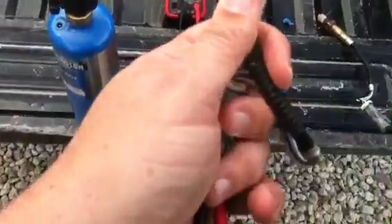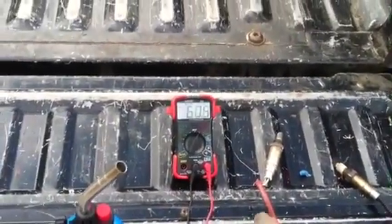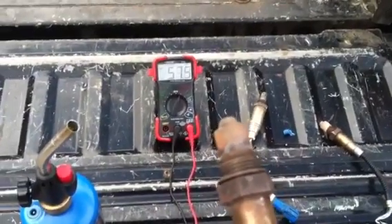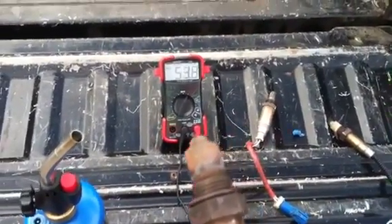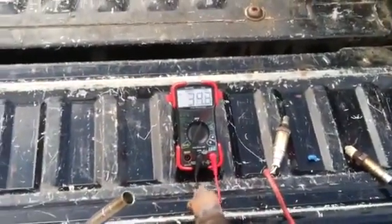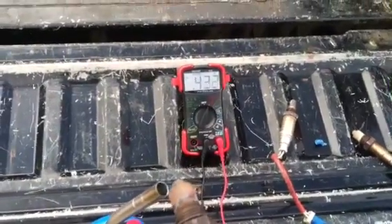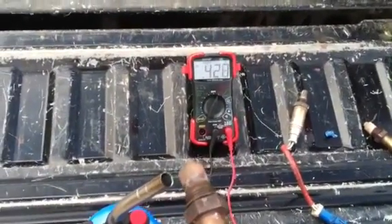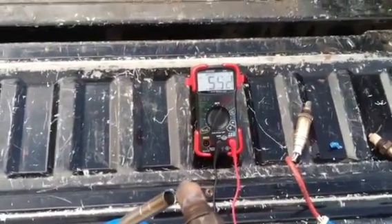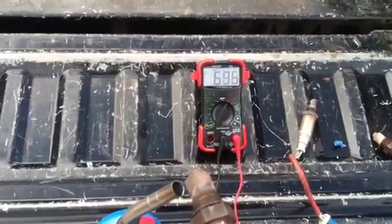Here I've got a different setup — I'm kind of just holding the pins in there with an adapter. This is the last one, by the way; I've already tested the other ones. These take a little bit longer to react because these are before the catalytic converter, so they deal with hotter exhaust temperatures. As I put it in the flame, you'll notice that it goes up — it may jump around a little bit — but there's 0.4, 0.5, 0.6, 0.7.